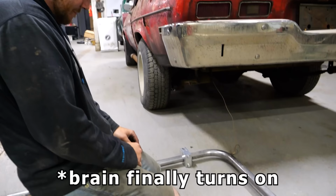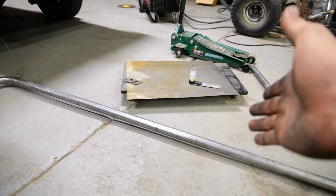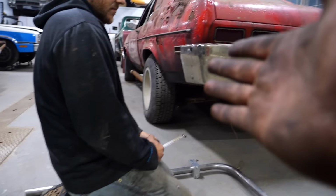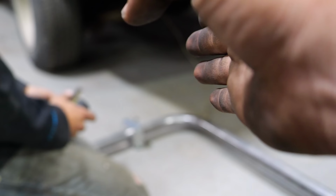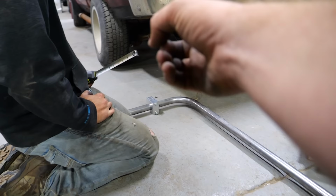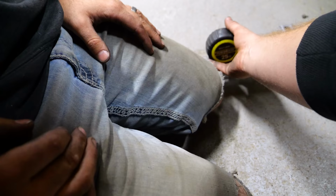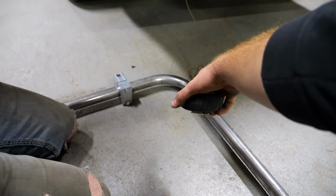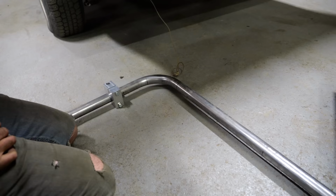We've already consumed 4.5 inches, so 47.5 minus 4.5 is 43 inches. We're going to take off another 4.5 from that. We need to make a mark at 39.5 inches. Let me think. The line was on the outboard, and it was too far that way, so measure from that line. Is this 5.25 or is this 5.25? Okay, so 39.5 inches from the end of that bend, not the line. We're going to place a block, and 5.25 after that.